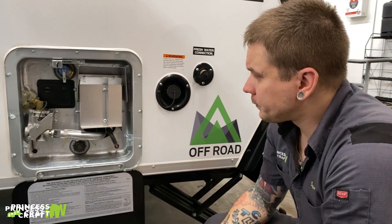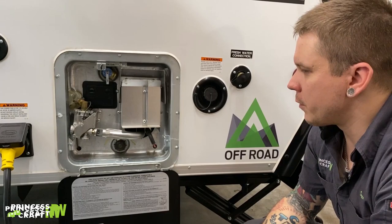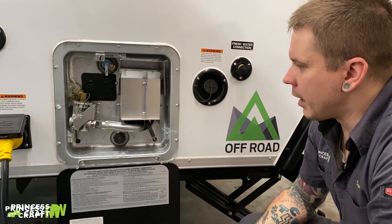Other than that, again, the flip side of that conversation, the manufacturer wants you to push 6 gallons of water into the unit before lighting it. Again, you're going to use the hot side of any spigot to do so. So that flow is going to initially be very interrupted, very sputtery. Once that flow normalizes, that is your indicator that you can go ahead and light this off.